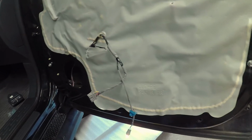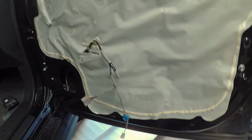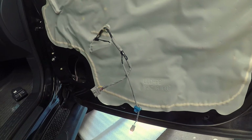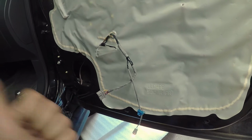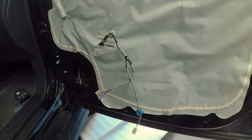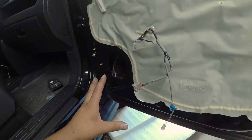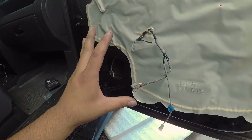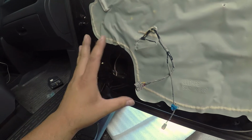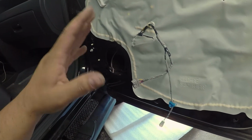So I'm just trying to minimize that. Whatever I did in the past, clips could be worn out. Something went wrong, and the door never shut like it used to, with a solid thud. At high volume, the door started buzzing here and there. So it's definitely a good idea to put some kind of foam or padding between the panel, the bracket, and the bracket to the speaker, so there's no transfer of vibration throughout the door.